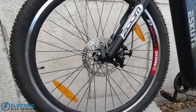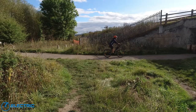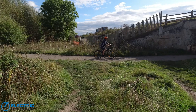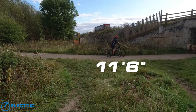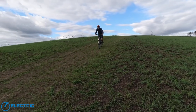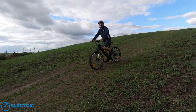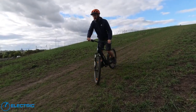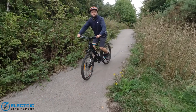The Natuno uses Zoom mechanical disc brakes with 160mm rotors. Our brake test confirmed their effectiveness in terms of power, with an average stopping distance from 20mph of just 11 foot 6 — that's 3.5 metres — and that's an impressive result. The Zoom mechanical disc brakes provide very powerful and effective braking. They were reasonably graduated; they easily let me descend a 15% gradient under control, though if you squeeze the levers very hard and quickly they provide tons of immediate stopping power.